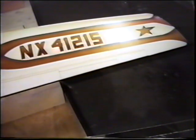Oh yes, the final clear coat is Prestige, wet sanded with 600, then 1500 wet or dry, rubbed out with 3M Finesse-It.